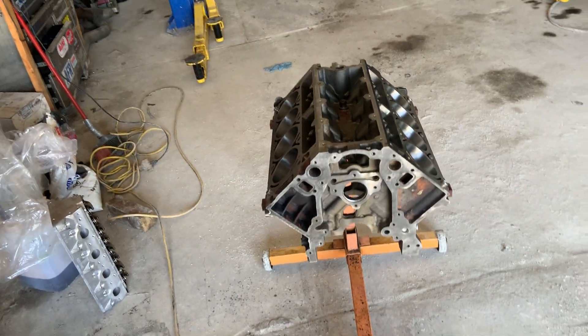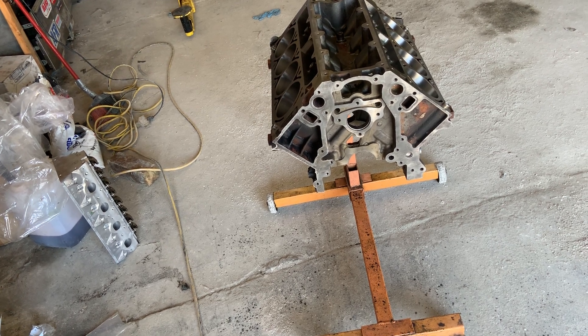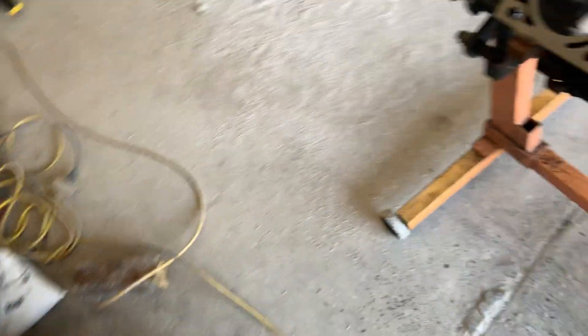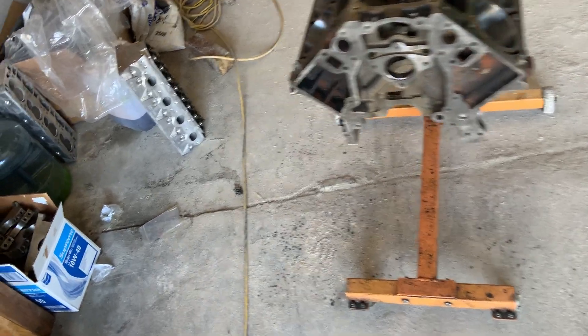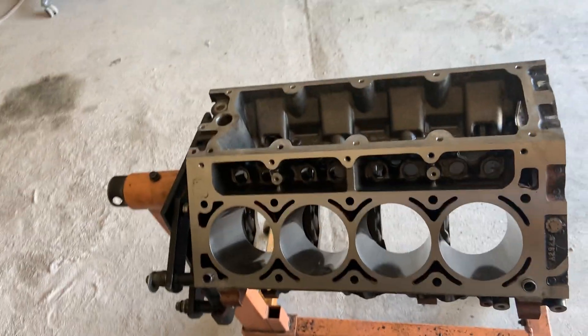That's going to make a really potent six-liter on boost. For the hot side, I have a few options - I have several On3 manifolds but I don't like their manifold because of plug and plug wire accessibility. I have another Trick T6 manifold like the one on that truck. If I run that T6 manifold I'll need an adapter to go to a T4 flange for the BMF turbo, which is pretty much a dead-on copy of a Precision 76/75 in my opinion.